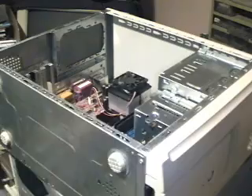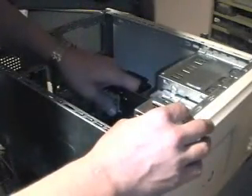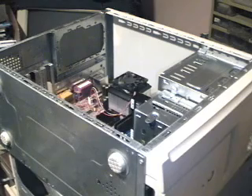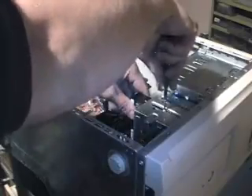The next thing is the hard drive. There are little slots down in here where you get it set in. Also, there are settings on the back of the hard drive for slave or master — make sure those are set properly for the application you're setting them up for. Normally it's master, but some people get a little weird. Slide this forward as close as we can. You'll notice it's got holes — you want to make sure they're set up just right. There's another screw on the inside.